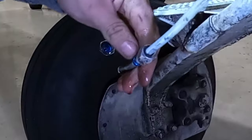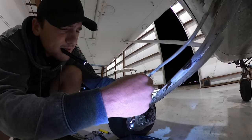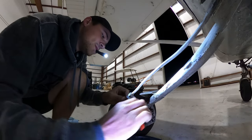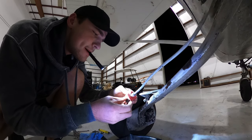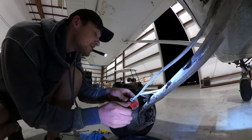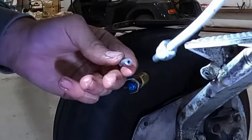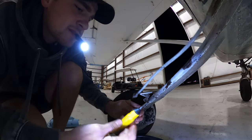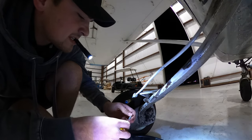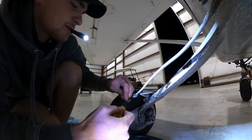This is the little sleeve right there — you can see it's leaking now, as expected. I need this sleeve to go up a little further. Now I'm gonna demonstrate what I'm gonna do. There's this nice little tool here — when you cut it, it squishes in a little bit of the rigid line material, and so what you do to get rid of that is you twirl this little guy around.